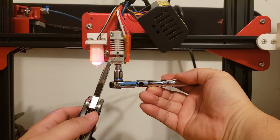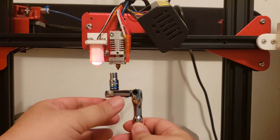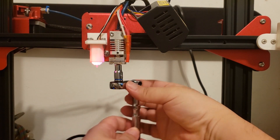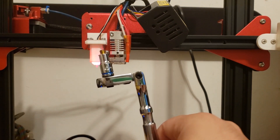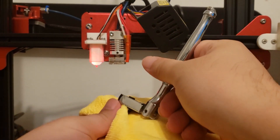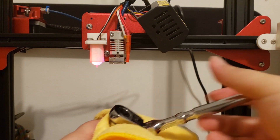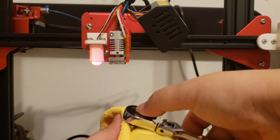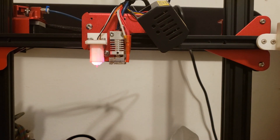I'm using my Leatherman, but if you have an adjustable wrench go ahead and use that to prevent any movement in the heating block while you're unscrewing the nozzle with your socket wrench. If you've turned off your printer or the nozzle has cooled down, bring the temperature back up — plastic near the threads can bond with the heating block when cooled, making it much harder to unscrew. Heat it up and it should come out more easily. Because the socket wrench is metal it will conduct the heat and get hot, so make sure you have a rag handy so you don't burn yourself.